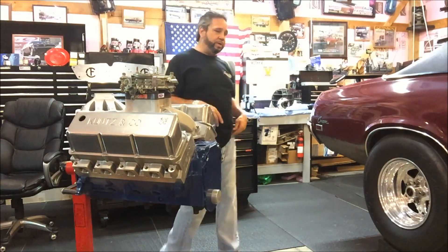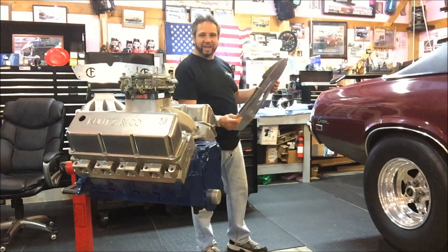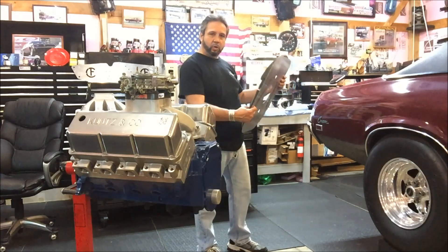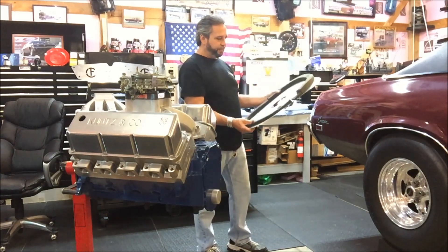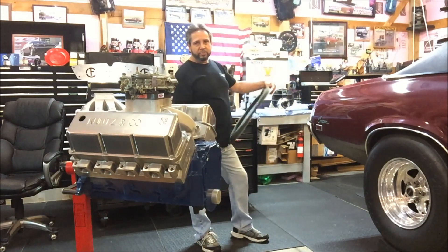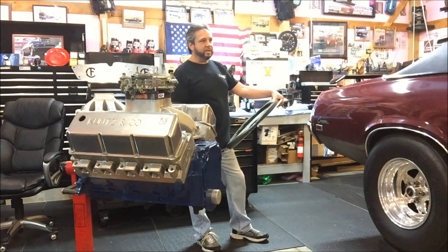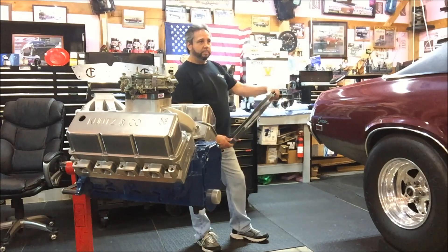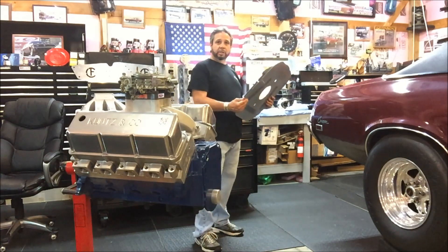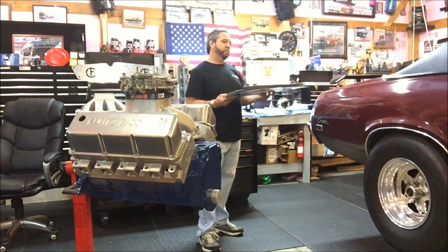Another project I'm doing is this little Ram air setup. I made it way back in 2013, but it was pretty flexible. I've added some flat stock to make it a little more sturdy, and I've got to replace the foam. Rody was always big on Ram air. Hood scoops don't do anything unless they're at least four or six inches in the front-facing aspect, compared to the cowl type — and I'm just not a fan of cowl induction hoods on a Ford. My car won't run without an air filter, probably from the turbulence under there, so I can put an air filter right on here.